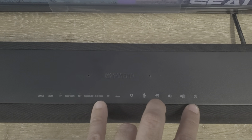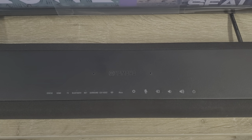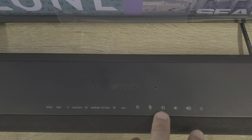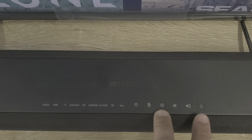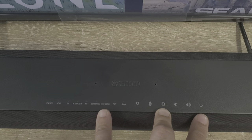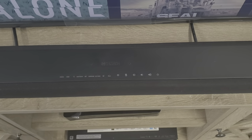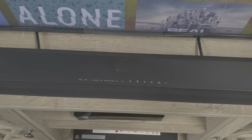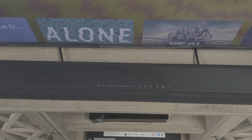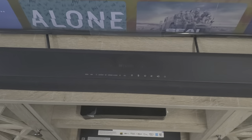This is done when the soundbar is off. If you want to enable it so that the feature is turned on, again — soundbar off — hold down the input button, then press and hold the power button. Up to five seconds, clear voice will not light up, and your soundbar will turn on. Now that feature is enabled. From the factory, it comes enabled — after ten minutes of no audio, that's what's going to happen.